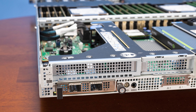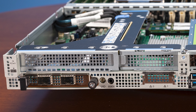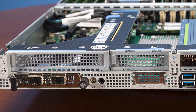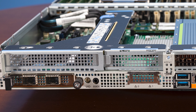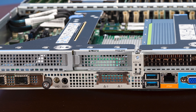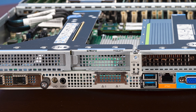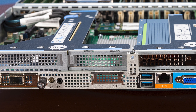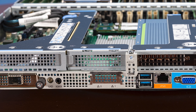In the center is a low-profile slot for our center riser. Below that is a small cutout that's not populated, which appears to be there for two network ports. Looking at the motherboard, there's a spot for a network controller that isn't populated in our configuration — that's why you see the cutout and the pads for the NIC; it's just not present in our system.